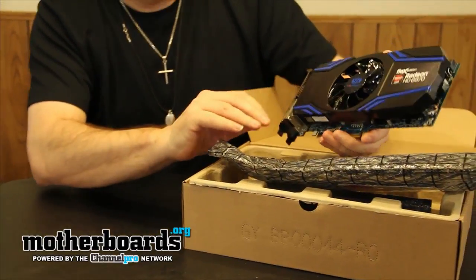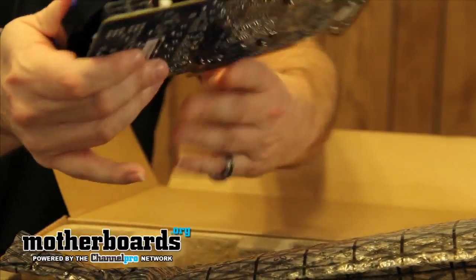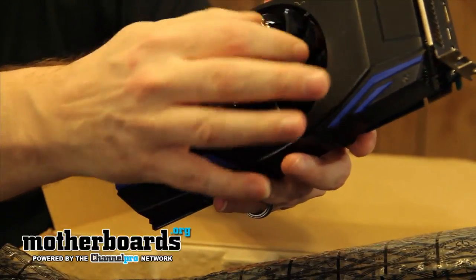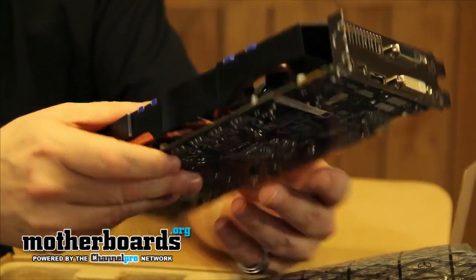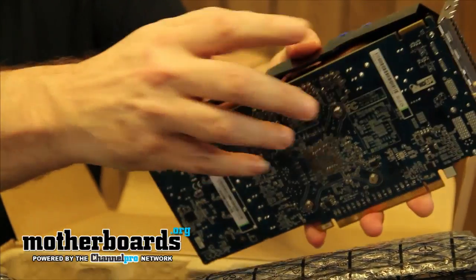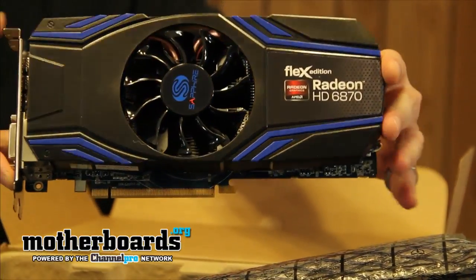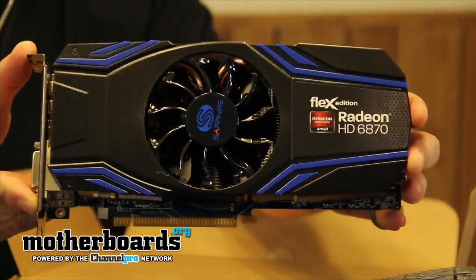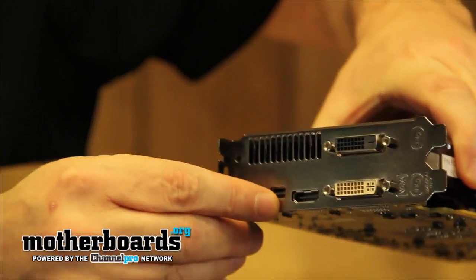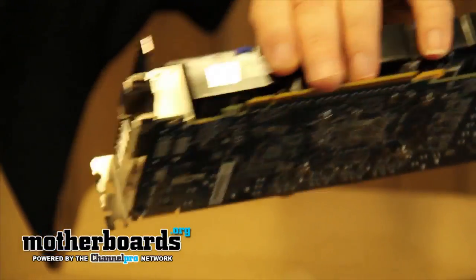Here we're gonna take a look at the card. This card is pretty crazy looking — the Flex Edition is not based on the reference design, it's totally aftermarket. You can see the copper heat pipes and underneath that is a giant heat fin, which all helps keep the card running cool. There are two six-pin power connectors. Here is the crossfire bridge connector. The card takes up two slots and is about 9.5 inches long — a little bigger than the standard reference 6870, so keep that in mind for your case. At the rear IO we have two mini DisplayPorts, HDMI, and two DVI ports. Notice the difference in color on the DVI ports — that is for doing the Eyefinity Flex Edition setup.